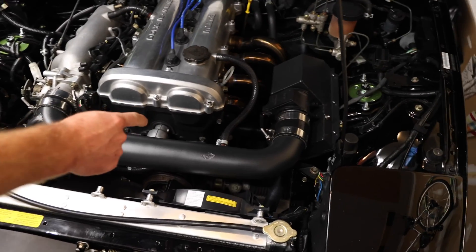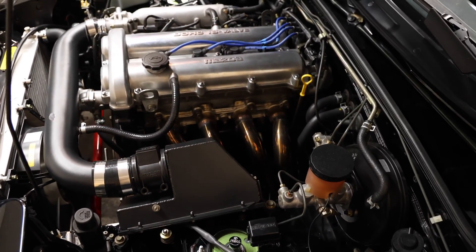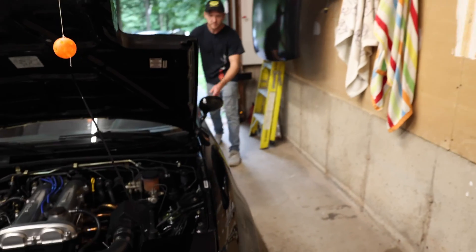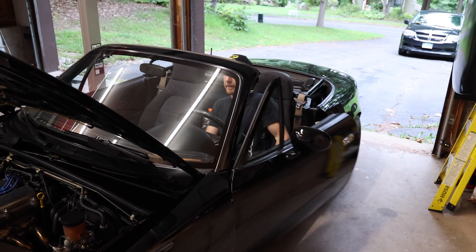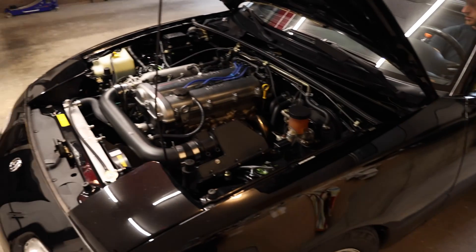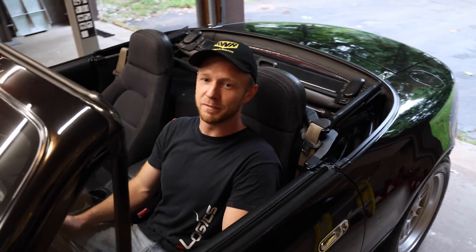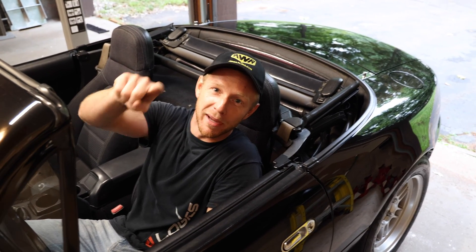The exhaust side was a little more difficult than the intake side — the exhaust manifold kind of gets in the way. With a header it's easier than with the OEM stock manifold, which can really stop you in your tracks. After reinstalling both mounts, we did a startup. These are softer bushings but not broken in yet — they will get a little softer over time. I can already tell there's less vibration. We're heading back to do the official vibration test.